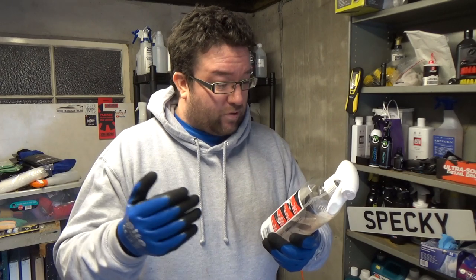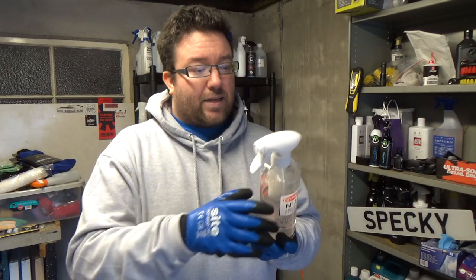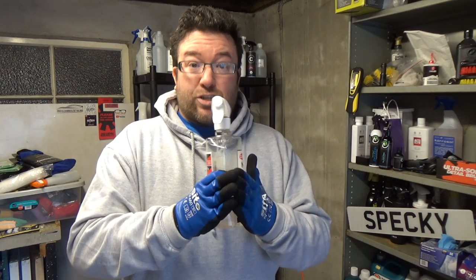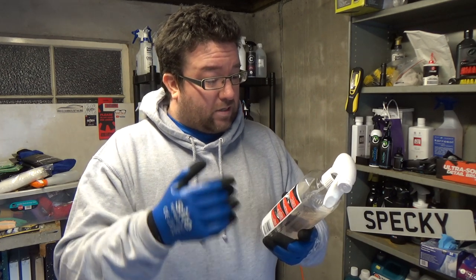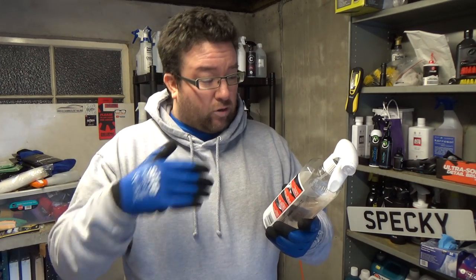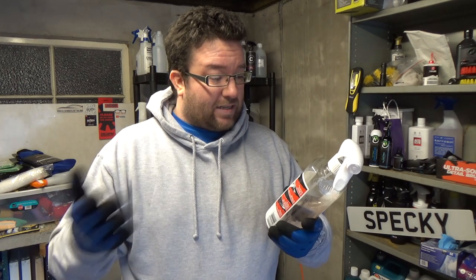Shake it well. Apply liberally to all surfaces and wheels — yes, good idea. They're not just saying it's for paint; use it for wheels too, because your wheels are going to have iron fallout on them from the metal-to-metal abrasion going on in there. Spray it on, and after five minutes it will turn purple. Rinse it thoroughly, ensuring all panel gaps are rinsed and any residue from the product is removed. Then go ahead and use Number One Super Gloss.